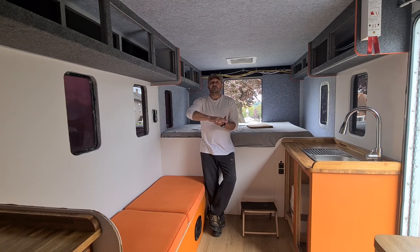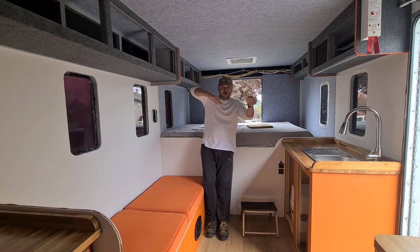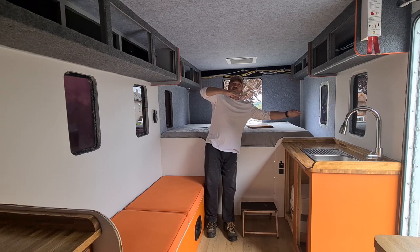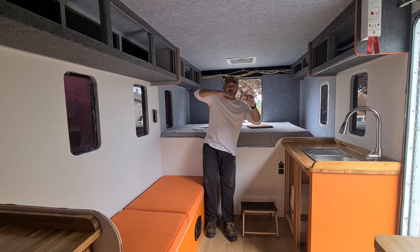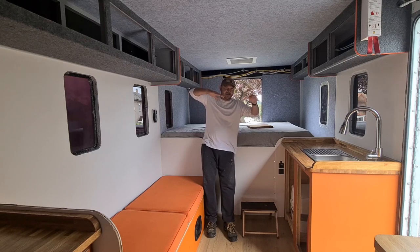I've got to adapt some flat roof brackets, which I've got for this vehicle, by putting the plates underneath. And when I show you up on the roof, you'll understand why, because the awning sits at an angle on the edge of the van, which has got a rounded profile on it. When the awning goes out, it sort of drops and sags a little bit because of the weight and the shape of the brackets. They need tilting or lifting a little bit, because as it comes back in, there's a lip that's hitting the round profile by about 10-15 mil, I'm hoping.